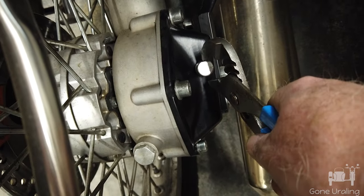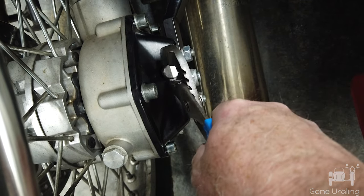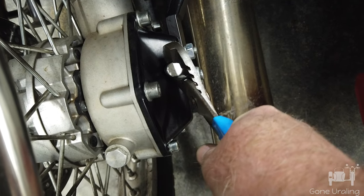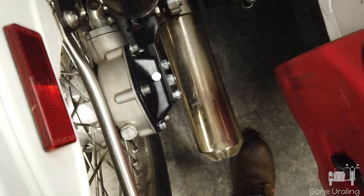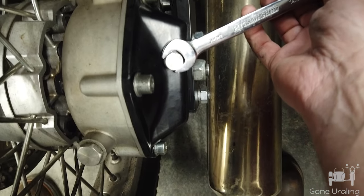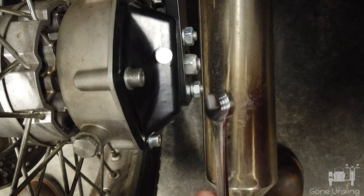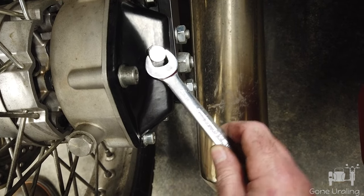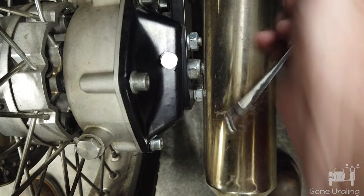I know this one isn't because I just put it back on. This metal cap actually comes off — if you grab up near the top, keep your pliers fairly open, grab near the top so it's harder to crush, kind of wiggle and turn and pull, and it'll come right off. Now we've got the cap off. The vent that's left has two flat sides on it and is 14 millimeters, thus the 14-millimeter wrench. I'm just going to unscrew this and take it out of the final drive.